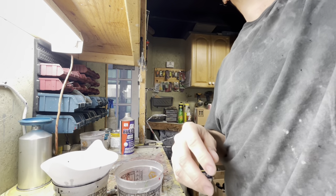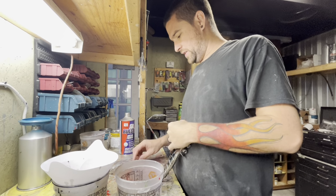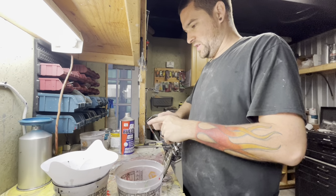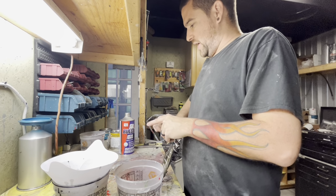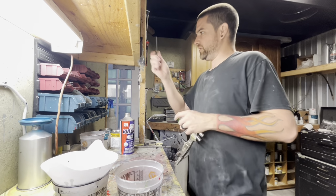As you've seen in the video, I Scotch-Brited everything down, but I never 100% trust myself, and you shouldn't trust yourself either. It's always a good practice to just put some extra adhesion promoter down. It's not gonna hurt anything.